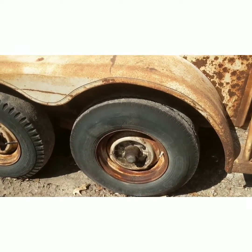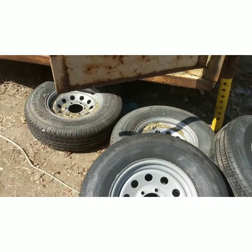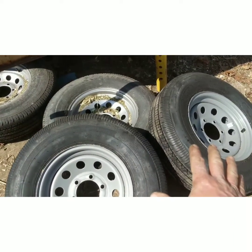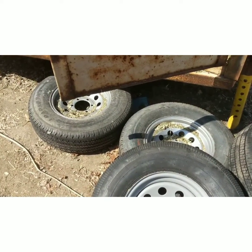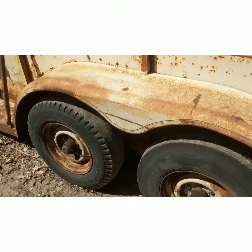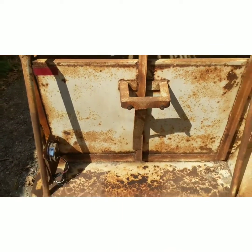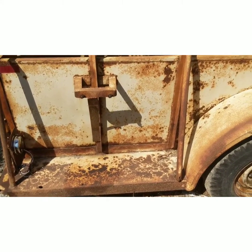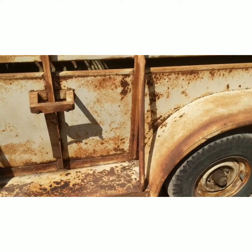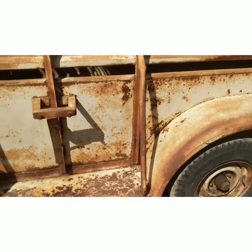This thing's got the original bias ply tires on it. When I bought the trailer, two new tires and rims came with it, and we've gone and picked up two more. Tried to match them up the best we can — they're not an exact match. So we're going to put a pair of tires that were bought together on one side and the other pair on the other side. It'll still have four new tires and new rims. We're going to check the wheel bearings too. We've got a spare tire rack — it's not recommended to mix bias ply and radial tires, but right now I don't have an extra radial tire for a spare, so we'll be throwing one of these bias ply tires on there. If it's round and holds air and you just need to get somewhere to fix it, that'll be the ticket.